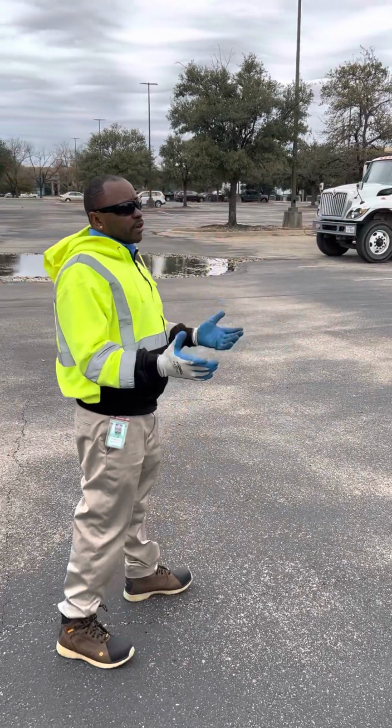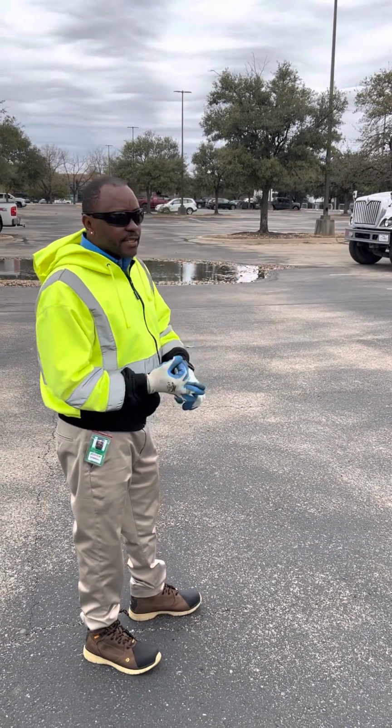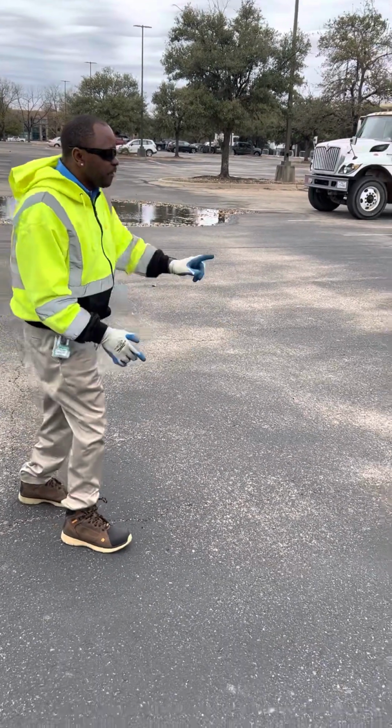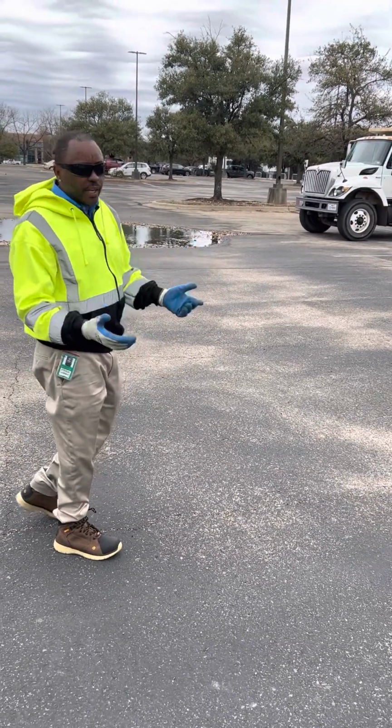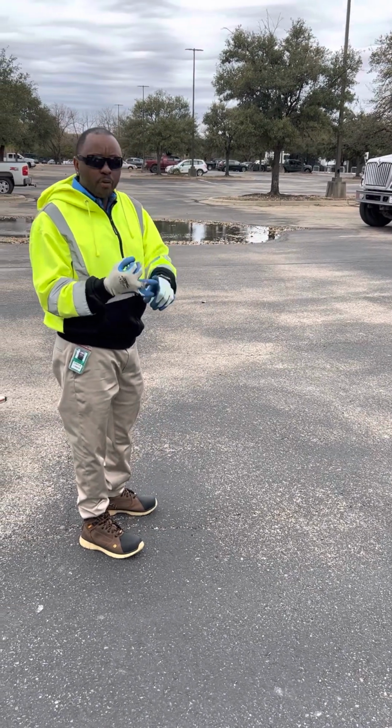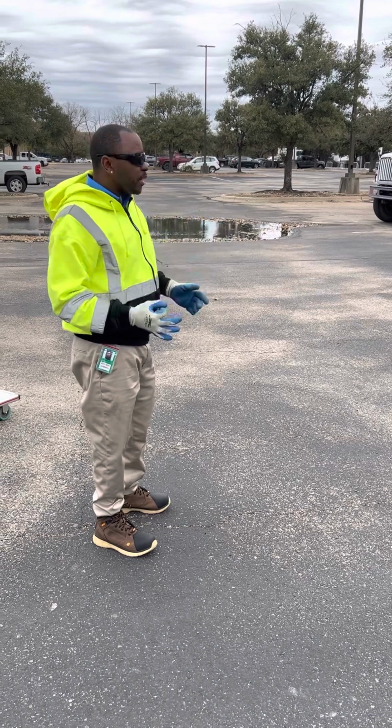So approaching the vehicle, we're looking for the 3 L's: leaning, leaks, and lights. First L, leaks. Check underneath for leaks, make sure we don't have any puddles. Then we're gonna check for leaning. Well, why would it be leaning? 3 reasons: flat tire, broken suspension, or an unevenly distributed load.